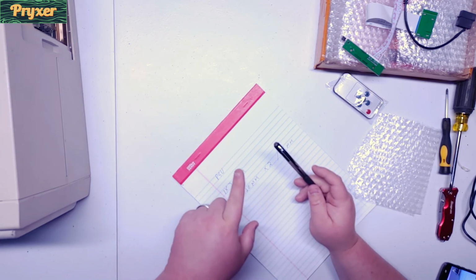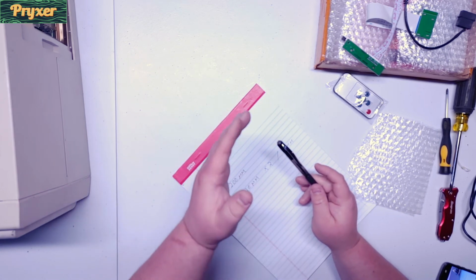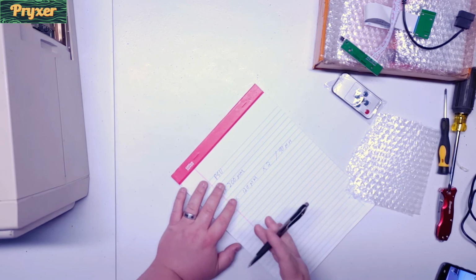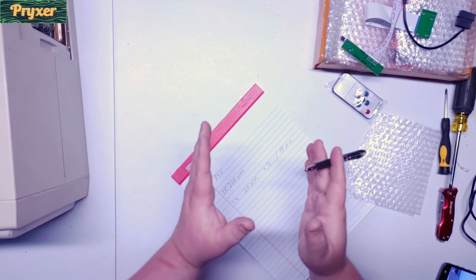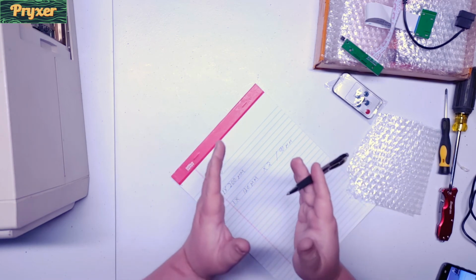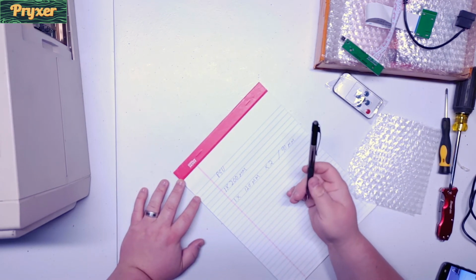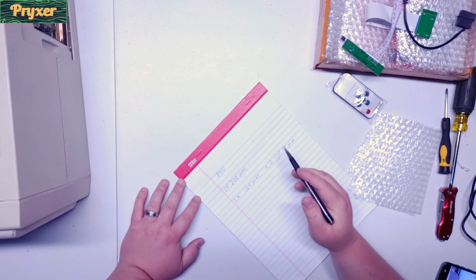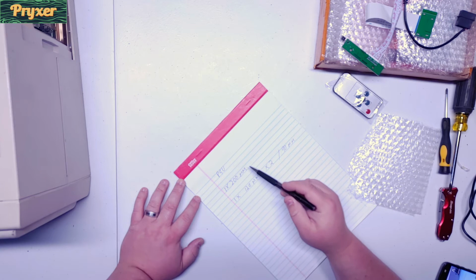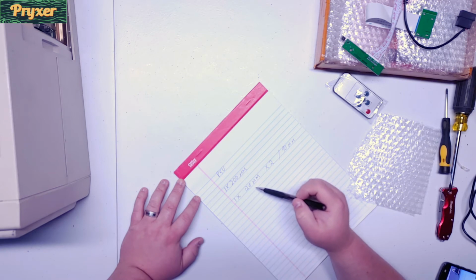Because that is another thing that we want to focus on, is trying to make sure that everything is not necessarily sealed up, but we want the path that the air takes through the case to be set. We don't want a bunch of stuff where it can leak out here, leak out there. We want that path to go in a certain direction. So we want it to come in the front and then go right out each side at the back. That way we can remove as much heat from these newer components, because newer components are going to generate a lot more heat than the old components. So we definitely are going to need fans. We know we're going to need a 200 millimeter, and even if the mounting is a little wonky, we're still going to try to put 120 millimeter side exhaust fans on it.